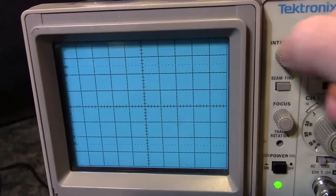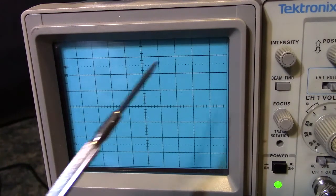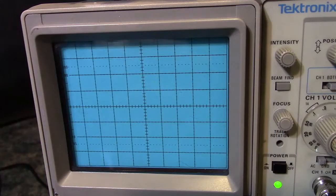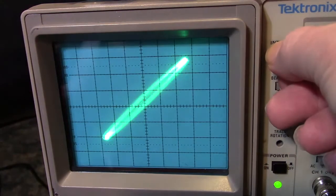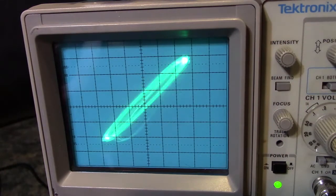I've got the oscilloscope set up here. I'm going to take my little screwdriver and put it into the tiny little hole provided on the front of the deck, right above the stop button. This only works when it's in play because the head has to be up where you can get the screwdriver on it. So I'm putting it into play and turning on the oscilloscope. Now you see the Lissajous pattern — I've taken the left and right channels and put it into XY mode on the oscilloscope.